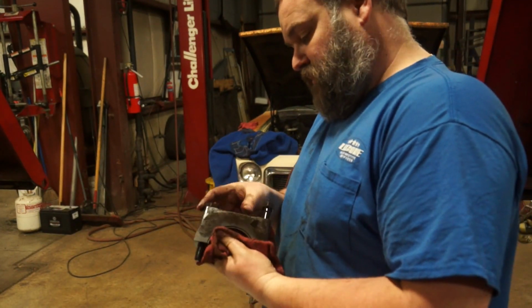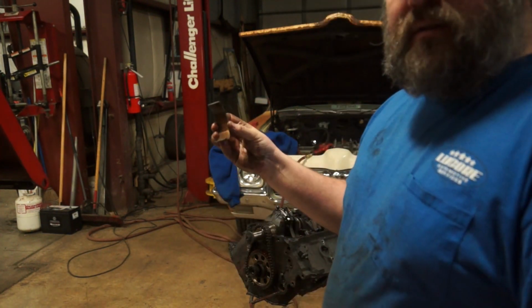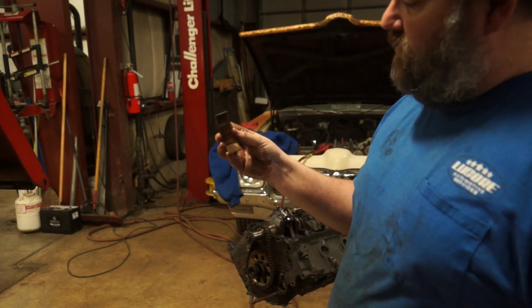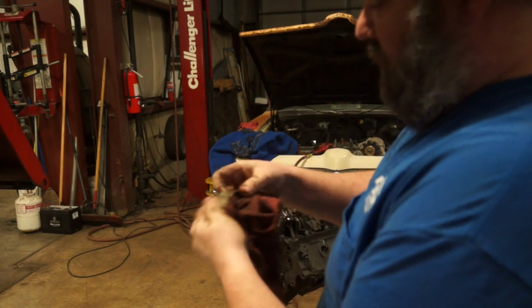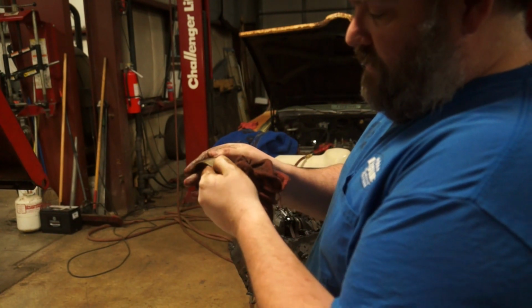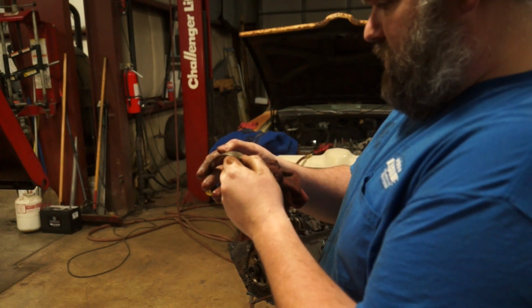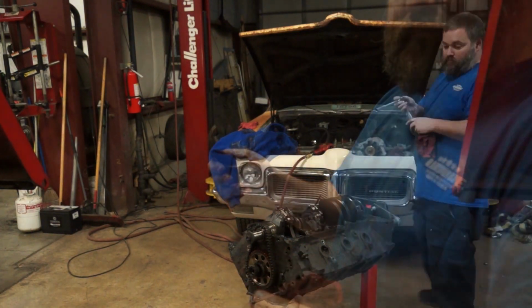It's all right. Wasn't planning on reusing the bearings anyway. You can see in this bearing also the coloration, that's not silver. So bearings were definitely very well worn, and there's no stampings on the opposite side. Like on the 304, it said Clevite on here, where you can see this here. And that just says 319-6808 AMC. So these are the original bearings that were in this car.